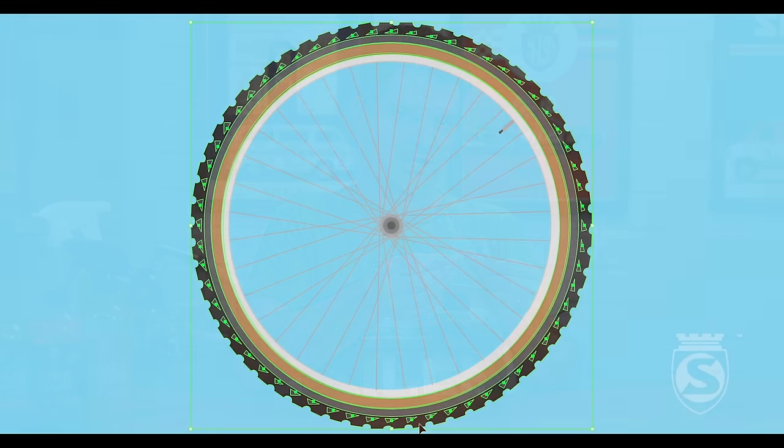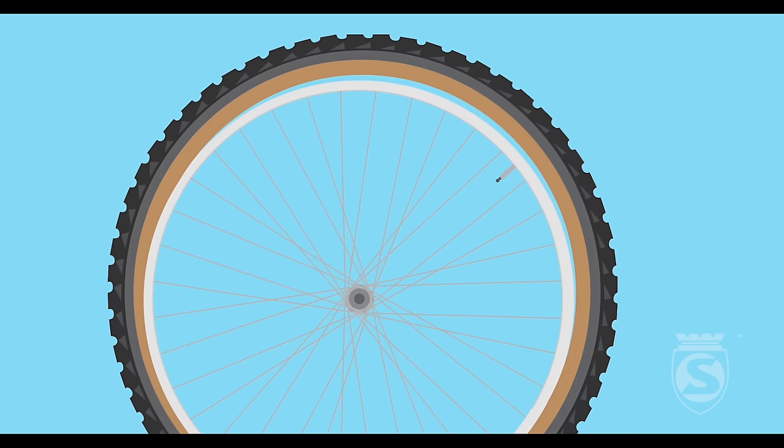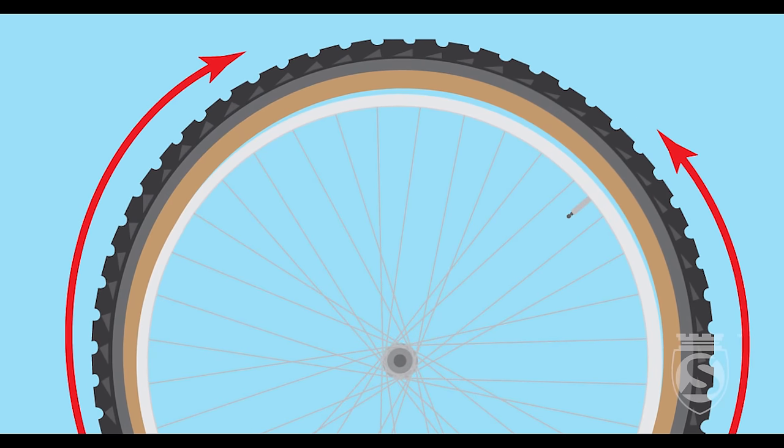You have to take advantage of that channel or you risk damaging your rim or breaking your tire lever. Think of it this way: the tire has a fixed circumference, but you can locally have a larger radius if the circumference is at a smaller radius somewhere else. If you put the first bit of bead at the bottom and push it up into that channel and work it around, the tire works around a smaller radius — and because the circumference is fixed, you'll have additional radius left at the end to get over the bead. So this is critical: have the valve stem at roughly 11 or 1 o'clock. Get the tire up in that groove and work it all the way around.